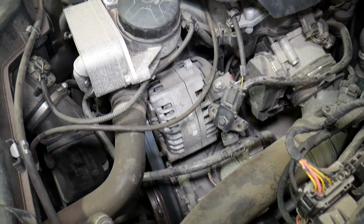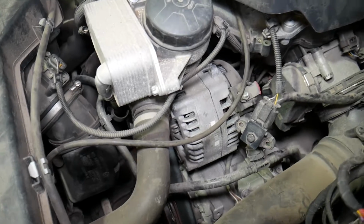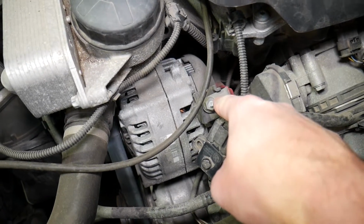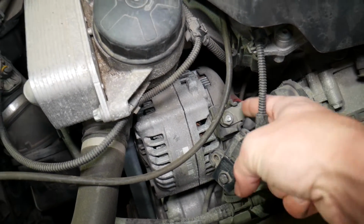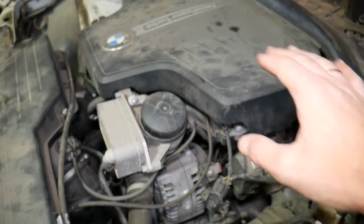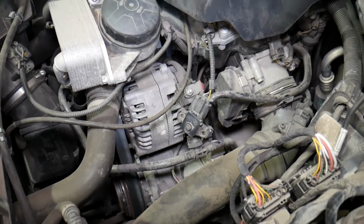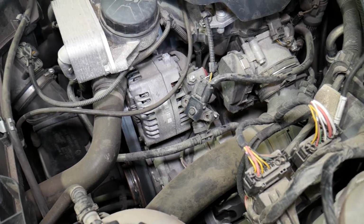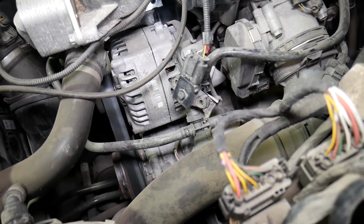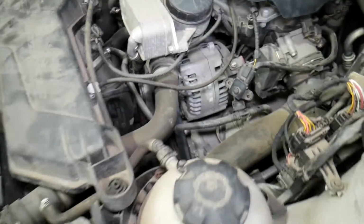And another thing now, guys, when removing and replacing, you have to have your car battery disconnected because this is a positive cable, and if you get it loose and you touch it somewhere or you touch that cable with something else, you're going to see sparks and you can burn your engine computer and other computers as well, which is catastrophic, guys. We've done that because we weren't careful in the past, and we want to share that with you guys so you can learn from our mistakes. But that's where it's located. The whole replacement video will be on Auto Repair, guys.